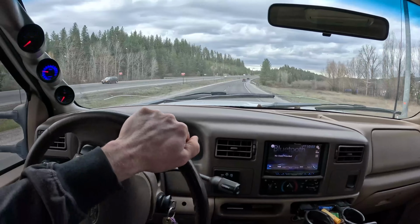I'm very excited. I cannot wait to get this thing painted. So let's go pick it up. Let's get in the shop. And we shouldn't really have to do much. I don't think he sandblasted the actual outside of the cab, just because I've heard the horror stories of it warping body panels. So I think he just did the underside, the firewall, and the inside. So we shouldn't have to do any prep. We should just be able to blow that off and go straight into our primer.